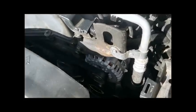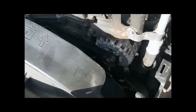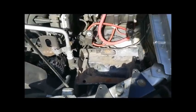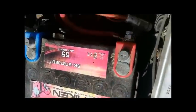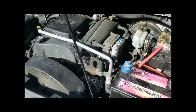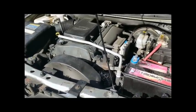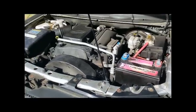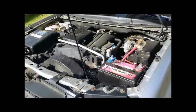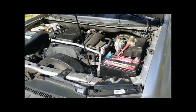The bracket assembly is back on and everything is reassembled. Coolant temperature sensor is in, alternator is in, and I put a fresh belt on — your belt diagram is right there on the vehicle, so now would be a good time to replace it if needed. All that's left is to put the battery in and start her up. The battery is all reconnected and tightened down. She started right back up. I'll check for leaks but I don't anticipate any. All in all, it wasn't a bad job — just set aside a block of time, take your time with some patience, and you should be able to accomplish it. If you liked this video, give me a thumbs up and subscribe to my channel.